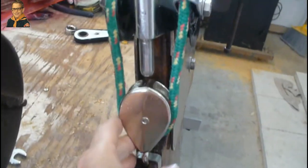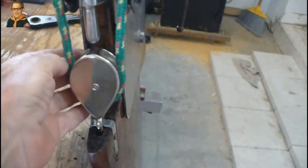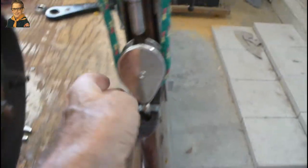And this right here is what keeps the rudder. Of course, it pulls the rudder and locks it into position. And if you understand anything about pulleys, you know that if you have a pulley in this configuration, if you have just a single rope and say put 20 pounds of force on the spring, then it'll just put 20 pounds of force on the back of the rudder.